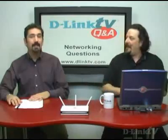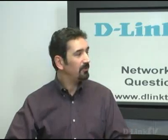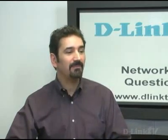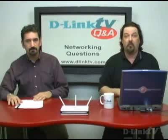One thing we suggest: if you're in a home environment, go ahead and write down your password, username, SSID, and passphrase key for your encryption right on the bottom of the router. If somebody can get into your house and access that sticker, you have a whole different problem and wireless security isn't it. Also, before resetting, make sure you've saved your settings to a settings file so you can restore them easily. And since you're resetting to factory default anyway, check for new firmware and update it at the same time to get the latest features.